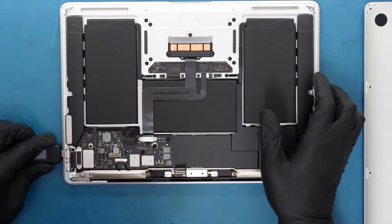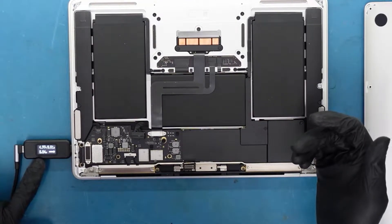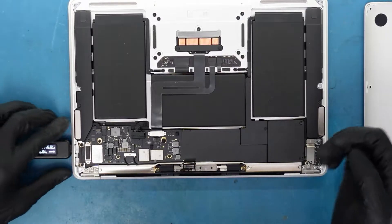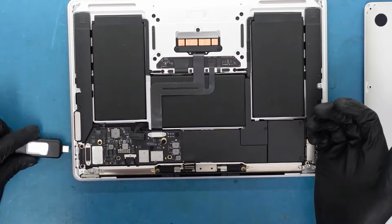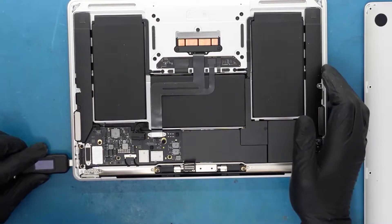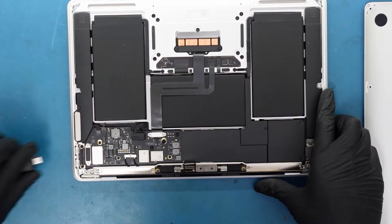Let's see what we get. If we plug it in and the board is completely dead — it's not powering on — there's usually a short. And we can see that there is a short. However, we're getting about 5 volts and 0.01 amps, so it's not really doing anything. We can also check the top port, make sure we're matching up, see if there's something else going on or if it's consistent. And it is.